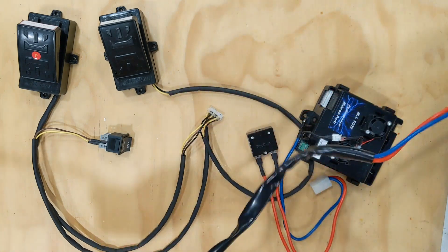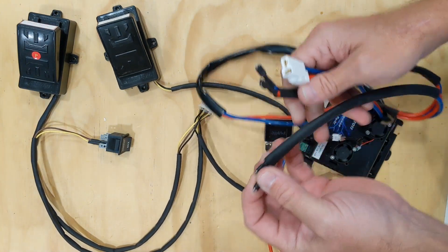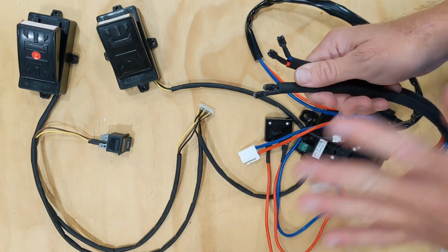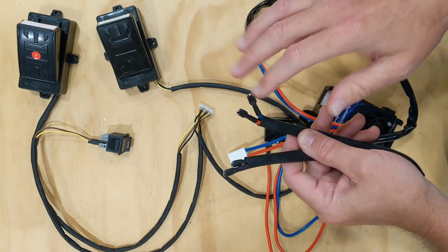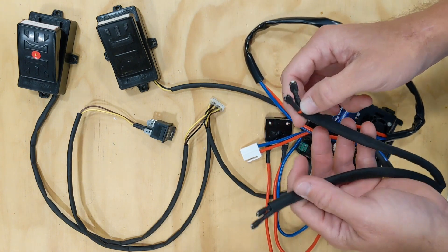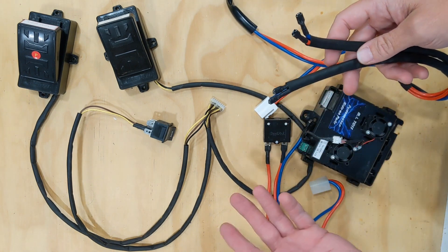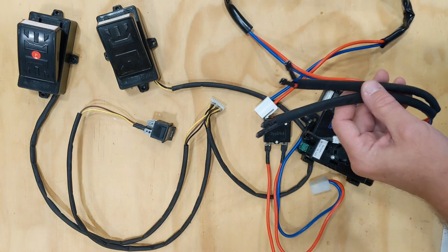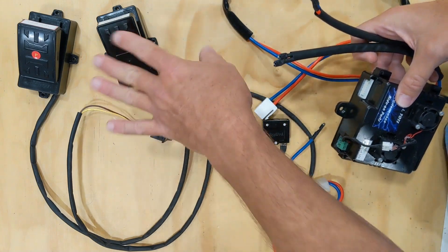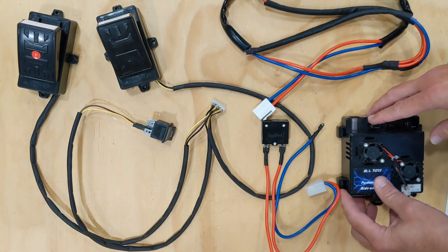The speed controller will be labeled for input and output — in from the battery, out to your motors. The motor wires give you about a 36 inch run, which should be more than enough for all vehicles. You've got two wires for one motor and two wires for the other. Once you have everything hooked up, before you button up the car, hit the gas pedal and make sure both motors are going forward when your switch is in forward. If one is going backwards, just switch the wires on that motor. If you have new motors that need a break-in, hold the gas pedal down for the 15 to 25 minute break-in period depending on which motors you have — just run it in high speed in the forward direction for that amount of time.